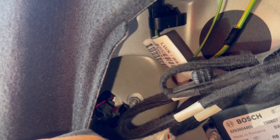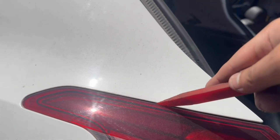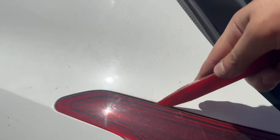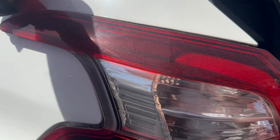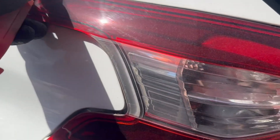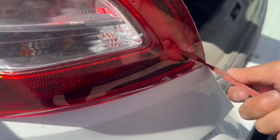After this, with a plastic tool from the outside, we will need to get in between the taillight and the body of the vehicle. Do not use a flathead screwdriver as you can damage the taillight or the body. You'll need to be patient while doing this as it's only held on by locators and sometimes they can get partially stuck. So on all sides of the taillight, with a plastic tool, just go in and try to open it as you go, and then eventually it will come out.